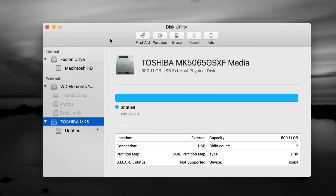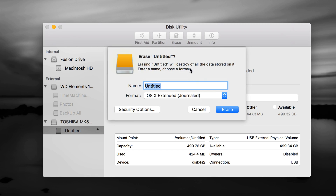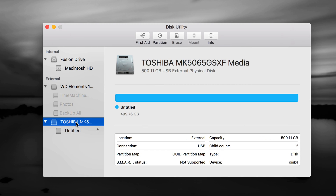A lot of times external hard drives just aren't working on your Mac because the format is wrong, so you have to format them from here. You should see your external drive listed — I have several connected. I have a Western Digital and a Toshiba; I'm going to format the Toshiba to show you. If you have an older one, you may need to erase from the second option — the partition — rather than the top-level drive.